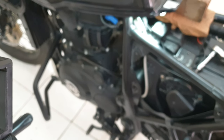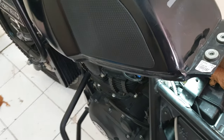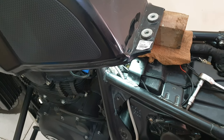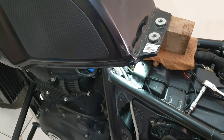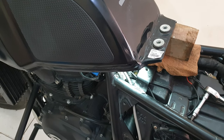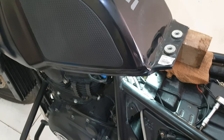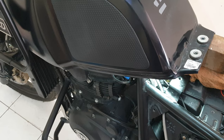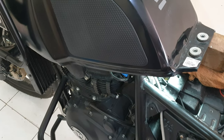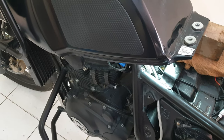The points to remember when setting the idle: if you set the idle too low, the clear indication is engine stalling — as soon as you let go of the clutch and accelerate, the engine stalls. That means RPM is too low. Also, a low RPM means the oil pump won't circulate enough oil, which is harmful — you're starving the engine of oil. Never go below 1200 or 1250 RPM.